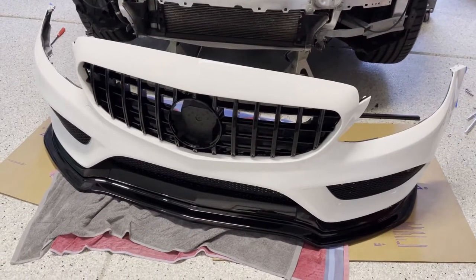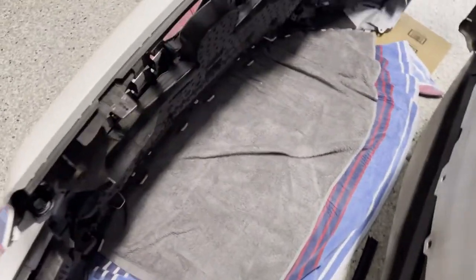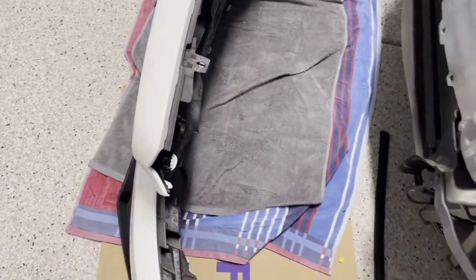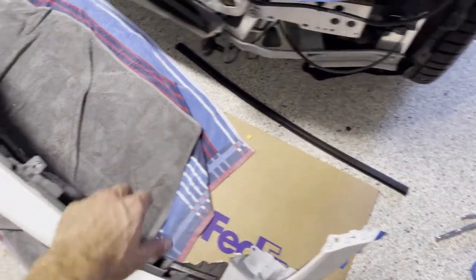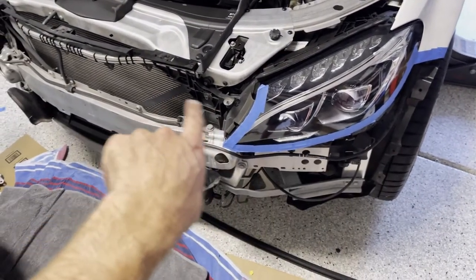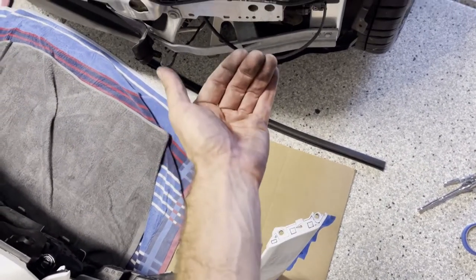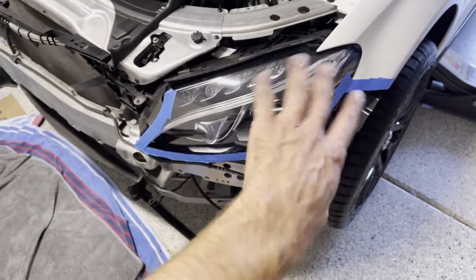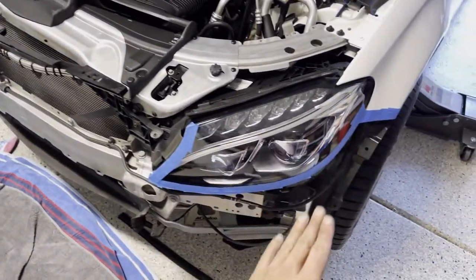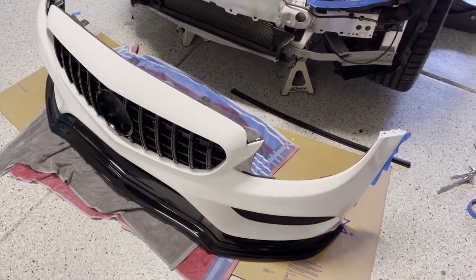Fast forward about another 10 minutes and I have everything on the back of the bumper in place — the foam guard and the rubber molding that goes around the outside of the grill. The last thing to do is put the weather stripping piece back into place, then slide the front bumper assembly on. Being careful as before: the teeth need to locate upward, so you go in and then up. I'll hang it off the front on top first, then work the fenders into position.